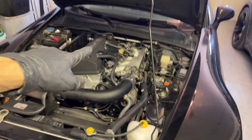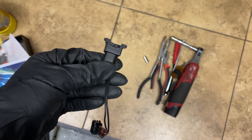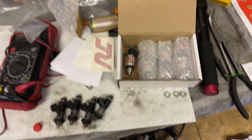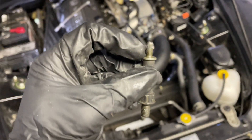Since the fuel rail is empty from pressure I'm going to move on to installing the fuel injectors. I have these RC 750s, and then I have these little conversion plugs — these will go from the stock Honda connectors to the EV1 style plug for the aftermarket injectors, so it should all be plug and play. There are instructions saying you have to space out the fuel rail — the issue is there are studs that go between there to support the fuel rail from the factory.